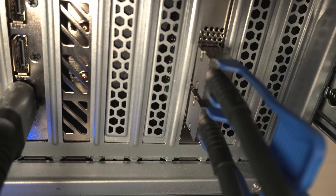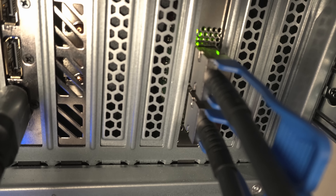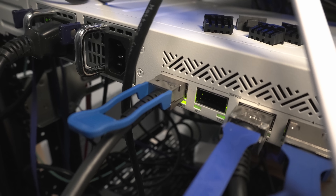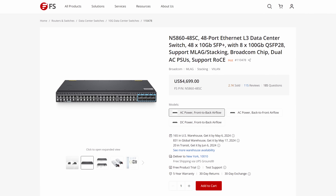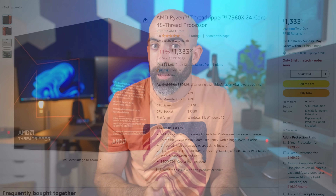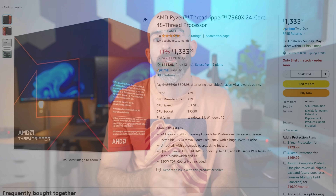I also got to upgrade to DDR5 RAM. And I went with a dual port NIC so that I could have one direct connection for RDMA and the other going to my switch to connect to the rest of the network. As of right now, my switch doesn't support RoCE, but hey, I'm terrible with money, so maybe that'll change. This ends my 100 gig journey — there clearly isn't anything else that I could possibly do to get better numbers. As we've seen, my real world use case doesn't even take full advantage of 100 gig.